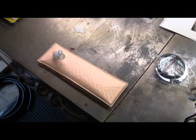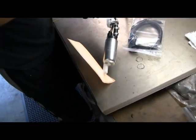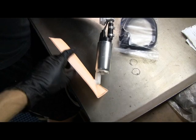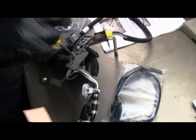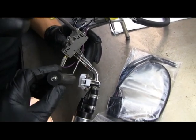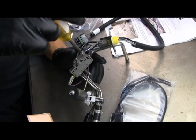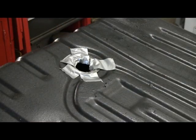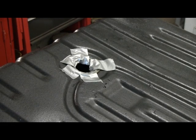The kit also includes a piece of Holley Hydromat as the pre-filter. The first step is to install the Hydromat onto the bottom of the pump — there's a nice little line-up tab for that. The instructions say to remove the sending unit mechanism so it will fit in the tank. They also say to put some tape around the hole to protect the Hydromat from ripping as you put it in.